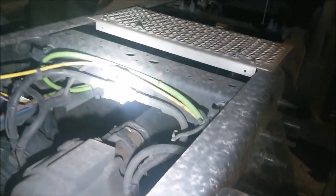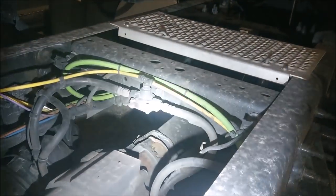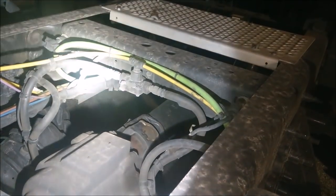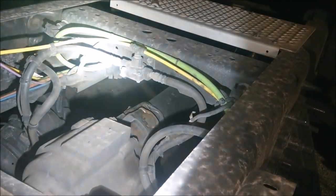I've got an International over here — this truck's running, so hopefully it's not too loud. It's actually got a T-fitting on the top. You would tie in on the driver's side, same way I did on that other fitting. You would tie it on the driver's side and that'll release the brakes on the whole truck.